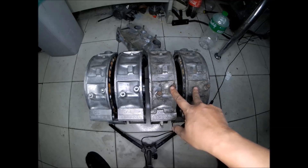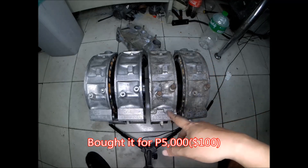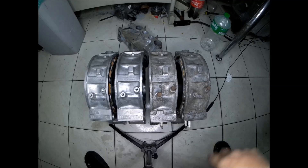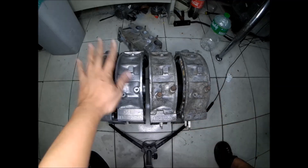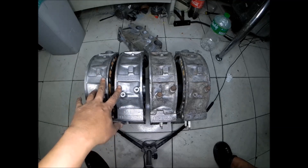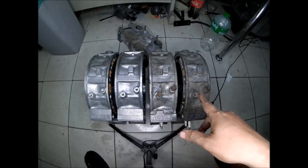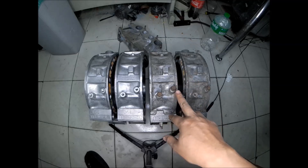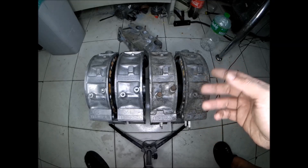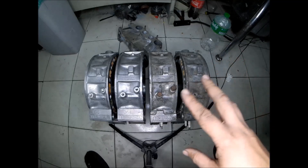But this one I got previously water flooded. That's why you'll see the color of the rotor housings — there is corrosion everywhere. I'll just be examining the rotor housings and deciding which one to use. This non-flooded engine has so much wear at the side and at the center, while this water flooded engine has minimal wear at the side and no wear at the center. But one of the rotor housings has chipped off chrome area, and even the metal surface under the chrome area is also eaten away by corrosion. So I'm still undecided which one to use from these four.